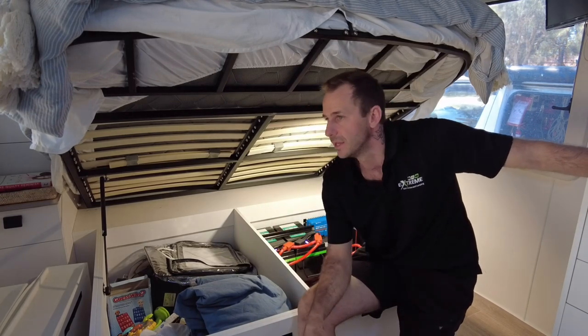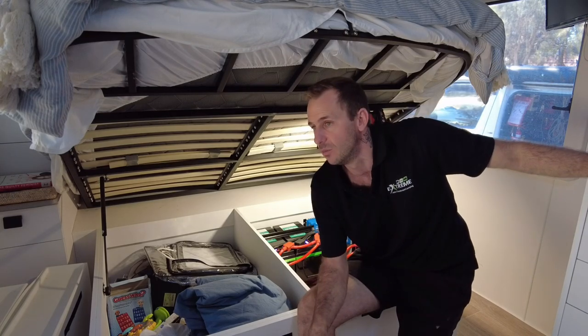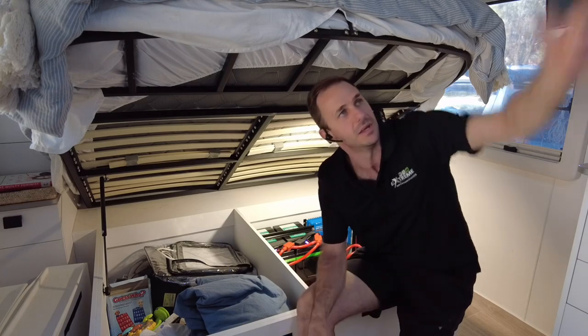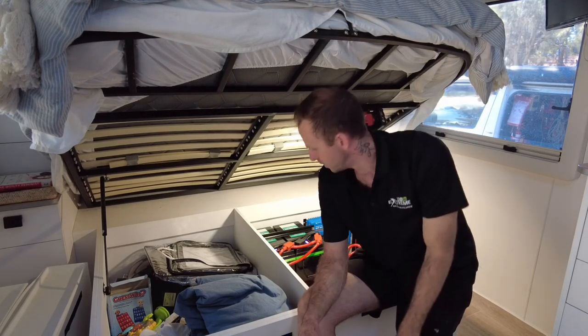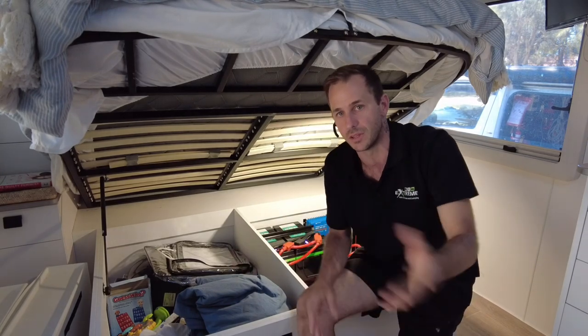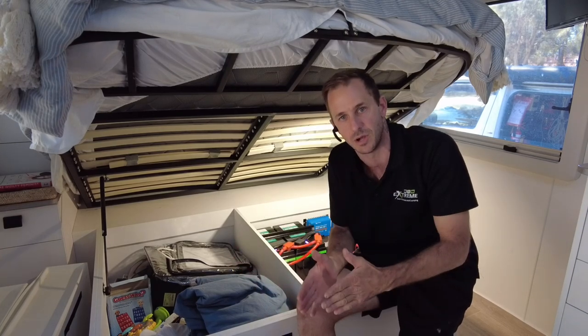So even if you wake up and it says minus 300 amp hours, well, if we had no sun, that's 6 hours and it's full again, right? But obviously it's going to be a sunny day driving around. Even if they're only getting 500, 600 watts from the solar on the roof, that's on top of the DC charger. It doesn't cut one off. No, not like some other systems that we all know. Then it'll work both at the same time, guaranteed.